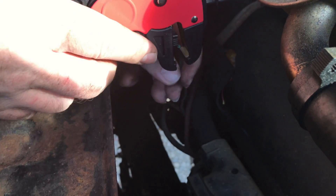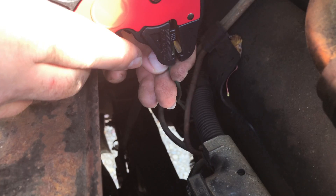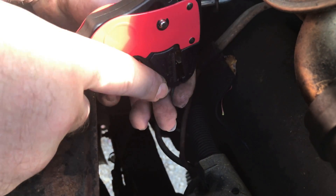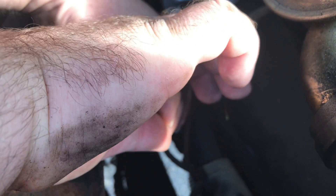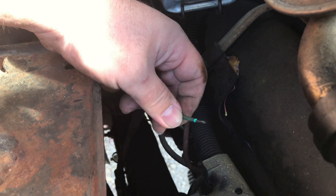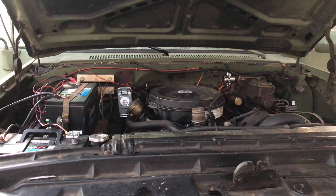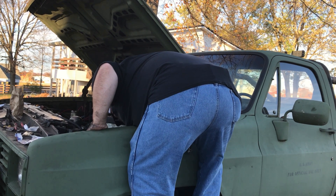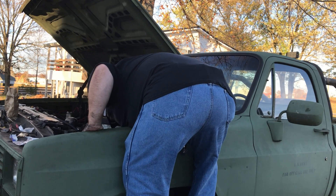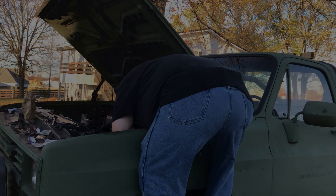He's just going to start off stripping the wire on the truck, just like he did inside for the demonstration. Twist them up there good, and you guys know the rest — that's the way to go. Once he puts his terminal on there, he'll be good to go. Starts much better — much better! And looks like we're at the end of the video. This has been how to install your glow plugs on your 6.2 diesel. Thanks for hanging out with me, guys. We'll see you next time.